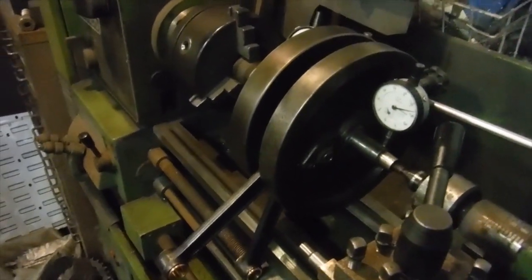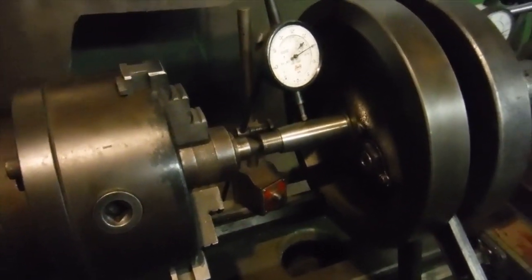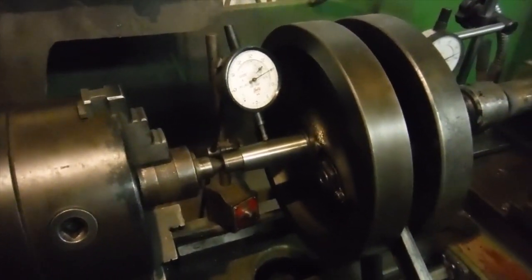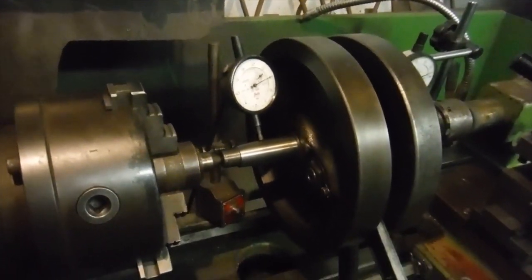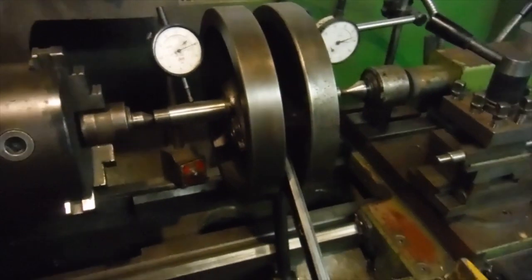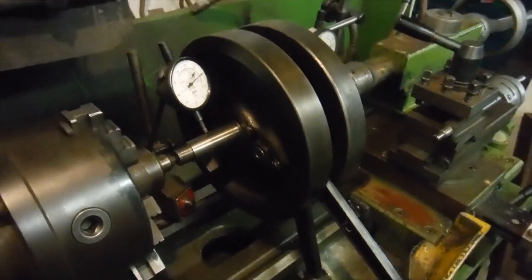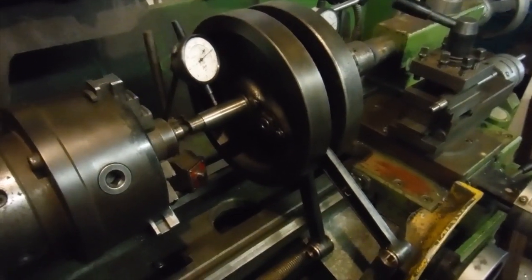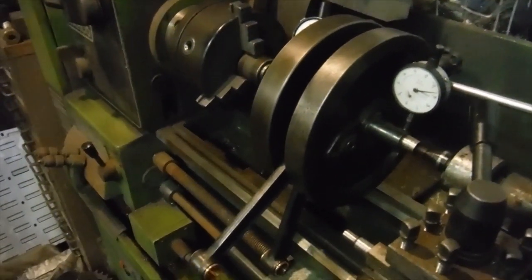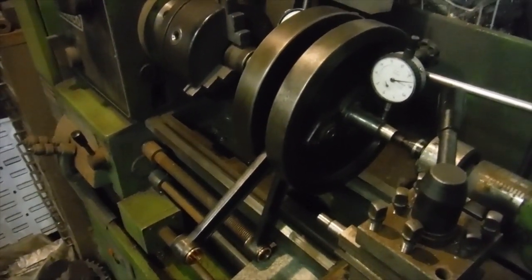I'm all okay for the timing side main bearing. We've got a little bit of a hurdle to get over on the drive side, and that is that we've got a new main shaft there, and it's just because new outer races for the crankcases aren't available, so I'm going to have to conjure something up to overcome some pitting in that. But I'm sure we'll get over it, and once that one's cleared and a solution's been found, then the engine can go back together and be put back into running order, I would think. But that's where we're at for now, and that's one major headache sorted out, so I'm very, very pleased with that anyway.